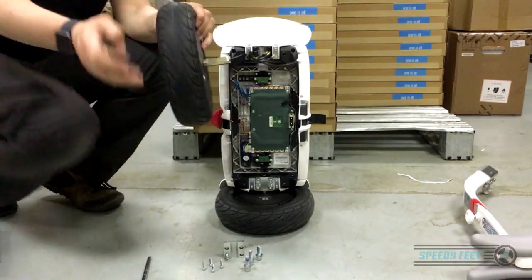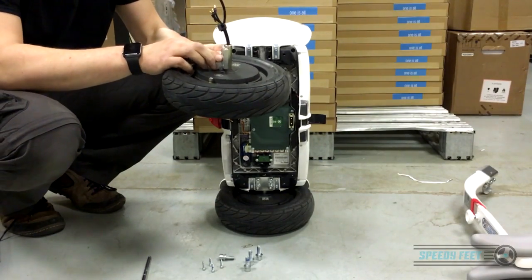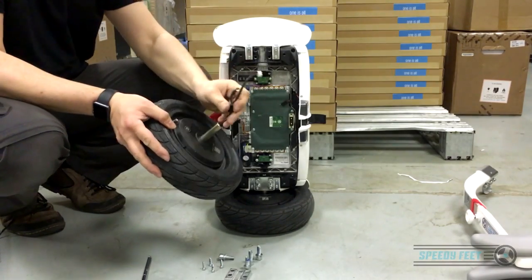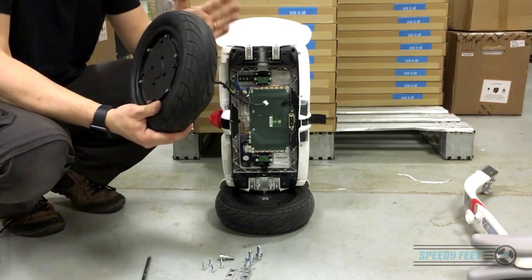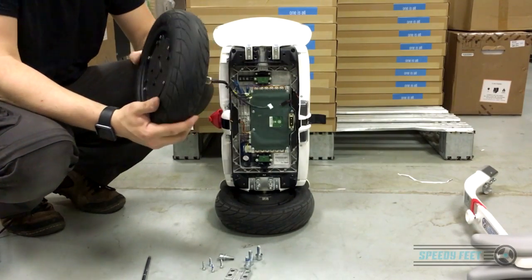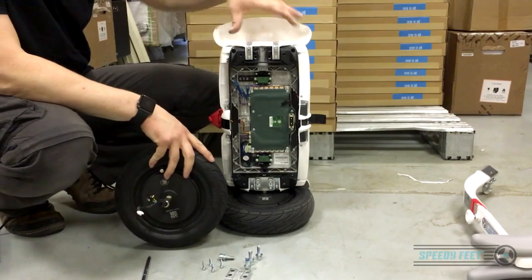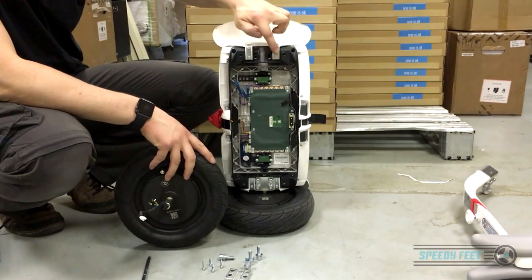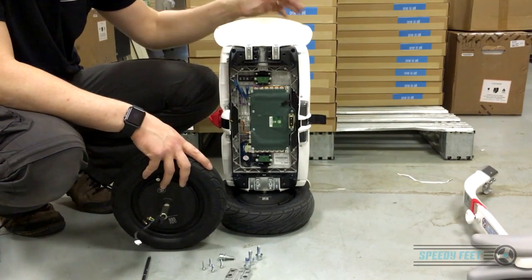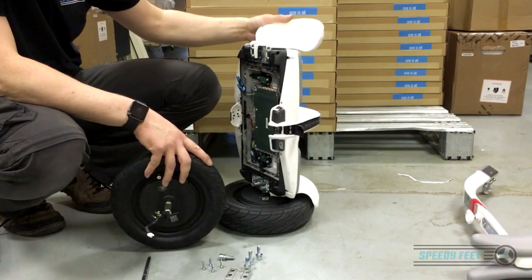What you've got is the flat of the plate which fits within the spindle recess — that's what keeps it solid and what you're riding on. There's a grommet, so keep that exactly as it is. If you're putting a new one on or just want more access to the tyre for replacing it, there you go — that's as easy as that. You can also take the opportunity to clean this out, and if you want to replace the mudguard, remove these four bolts and that mudguard unit comes off with its metal brackets. If you've snapped it or bent the brackets, you can remove them, bend them back into shape, or replace the unit.